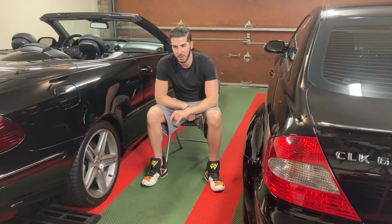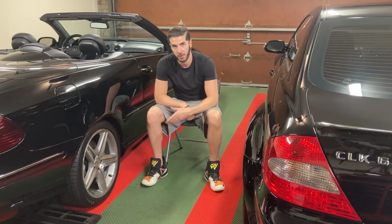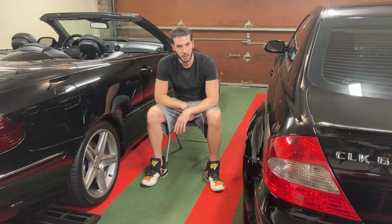The reason being is you can run 18x9s on them. When I flew out to London to see the original Evo 1 race car, I talked to some of the engineers out there and we discussed, I guess, a difference of opinion. Obviously it's a full race car, so they don't have any brake booster, they don't have any power steering, they don't have any of those types of components in there, no AC. I ended up having to modify the haunches to get the AC to work, relocating the horn, doing things of that nature, deleted the wiper nozzle, deleted the windshield wiper fluid, deleting a whole bunch of things, but still trying to keep it track-esque. I don't want an all-out race car and I don't want an everyday driver.